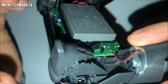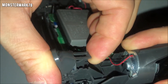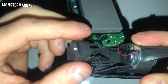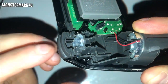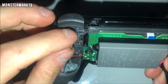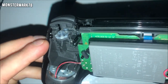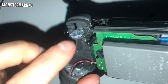To remove the R2 button, place your fingers on it, push down, then lift up from the front — up and over the latch — and it should pop out. You might need to pull a little harder. To put it back, place it down, pop it in, then push forward so it's latched. You can also check the rubber connector underneath — those are replaceable and very cheap, like five or six bucks — you can pop it up and pull it out without taking the whole controller apart.